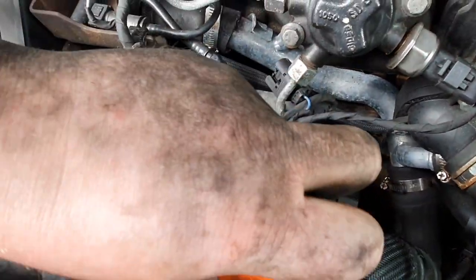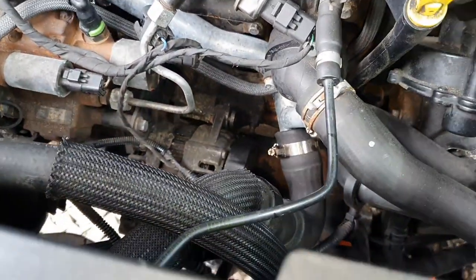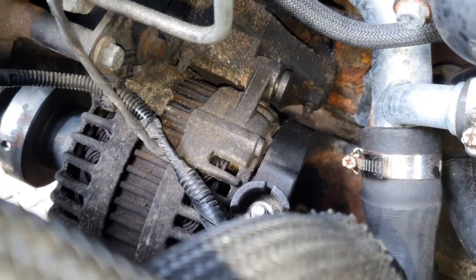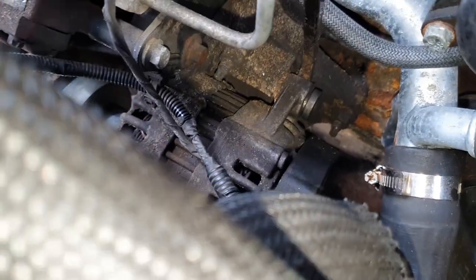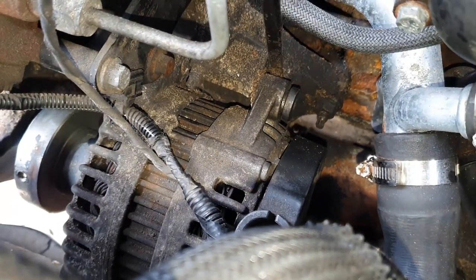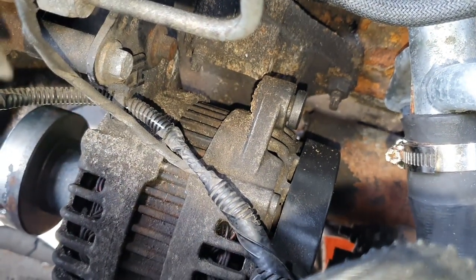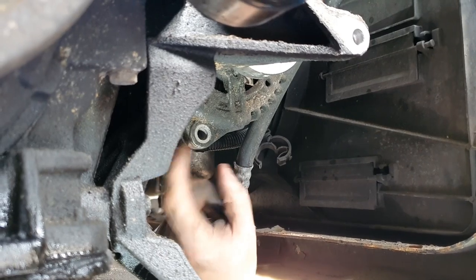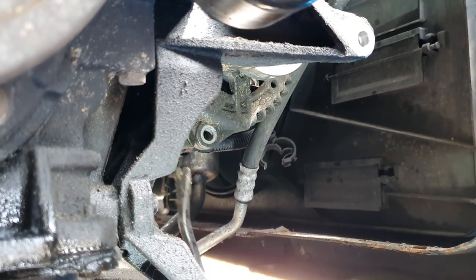What I'm going to do now is gently prise the alternator out from the bracket here using a pry bar. It's in there quite tight, and once I've got it cracked from the top I should be able to get back under the car. There we go — I've got it loose from the top. Now I'm going to use the pry bar on the bottom and hopefully it'll just come out of the way.